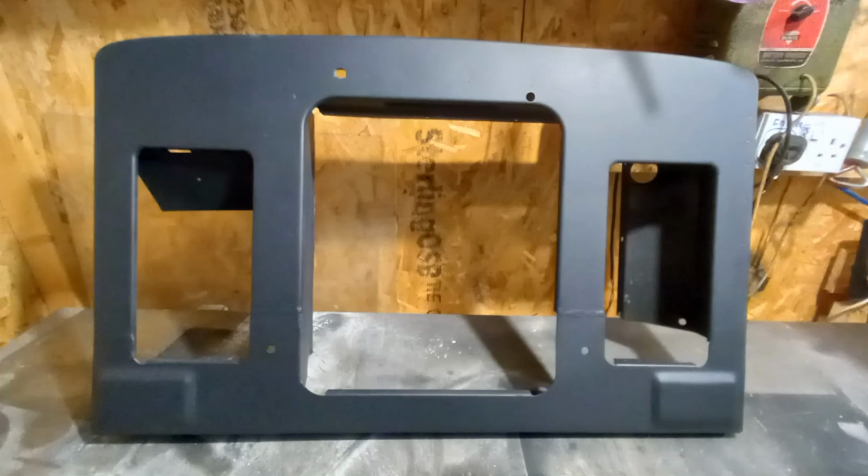And then we can see in the next clip, everything's all painted and looks really good. Well, painted, it's primed. That was U-Pol acid etch. It's stuck brilliant. No problems at all. The mordant solution did its job. So now this can sit on the shelf until I'm ready to paint everything else. So that is how you put a new bottom section into a rotten Land Rover front panel. That's how you get one ready for galv, and this is how it looks when it's finished.